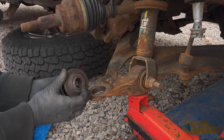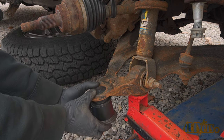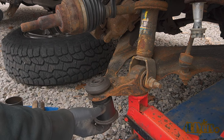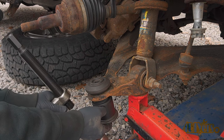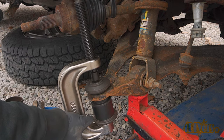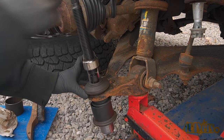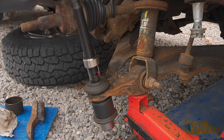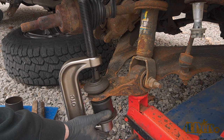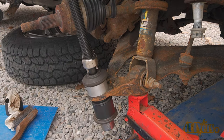Using a sleeve which fits around the ring of the ball joint, you'll need free space on the opposite side to push it through. Depending on the distance, you may need to change the attachments part way through if the ball joint press doesn't open up wide enough. Tighten the press so the ball joint is slowly pushed in. Add oil to the threads if needed — always make sure it's well lubed. Once you get so far, remove the ball joint press so you can switch attachments in order to fully push it through. Then tighten up the ball joint press until the ball joint is fully seated.